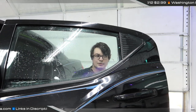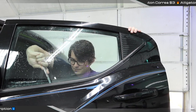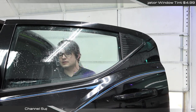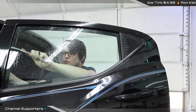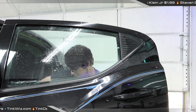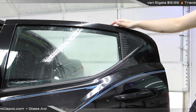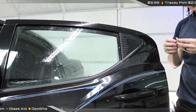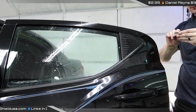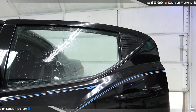What handled squeegee is the best? I really like the Fusion handled squeegees. Squeegee blades are always, like, a lot of that's personal preference. Most people gravitate towards something like an Orange Crush or a Blue Max. My disclaimer on this now is if you have a good scratch coat on your film, a flat out is really, really good. But if you're seeing scratches, go to a little softer squeegee. So like an Orange Crush would be a good option for you. Oh, these razor blades.